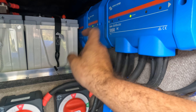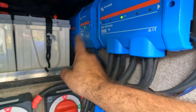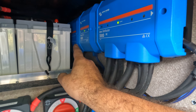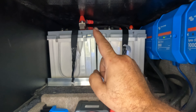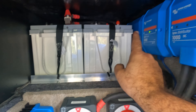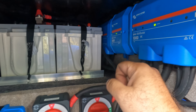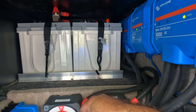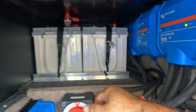The Power-In is similar but different than the Distributor: the Power-In does not have fusing, whereas the Distributor does. I believe Victron's design intent, per ABYC standards, is that you want the fuse within six inches of the battery — that's why the Power-In does not have fusing, whereas the Distributor does. On the topic of fuses, lithium batteries use MRBF fuses, whose interrupt rating is much higher and much safer to use with lithium.